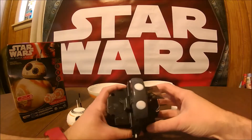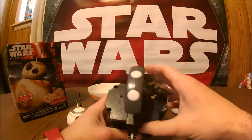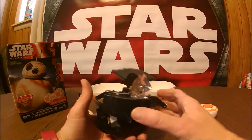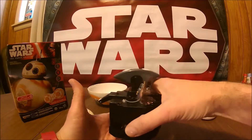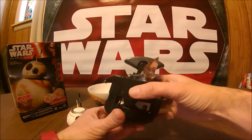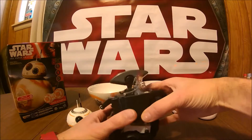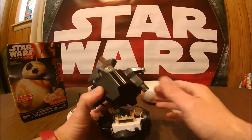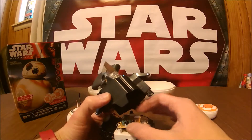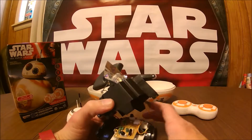The BB-8 itself is easy enough to take apart. There are four little Phillips screws holding it together. On each side you pinch this side and this side — the sticker has been torn apart, voiding the warranty — and just the top of his body comes apart. Normally there's nothing connected to it except what I have here. The speaker comes out kind of easy, but it's all part of the bottom, along with the main motherboard and the two drive motors for the wheels.